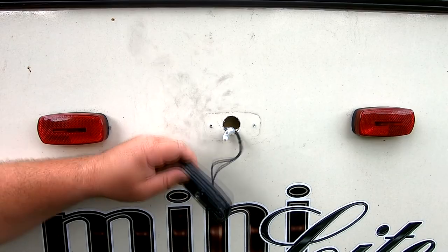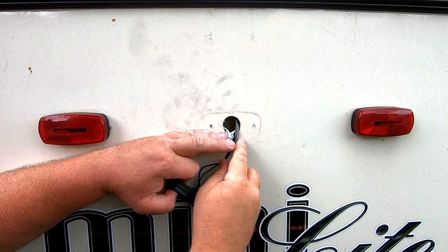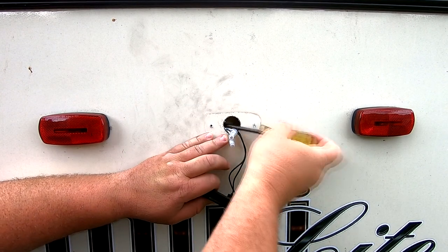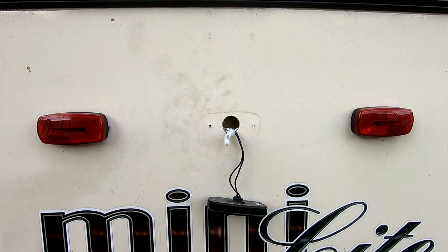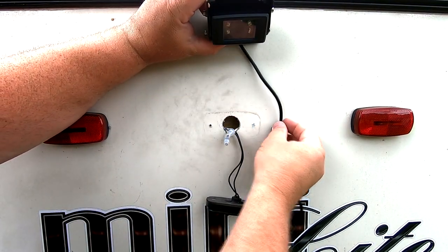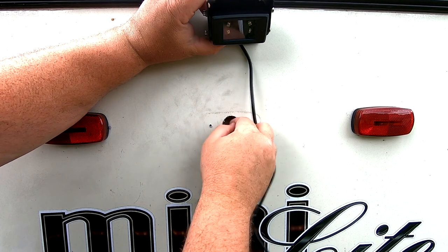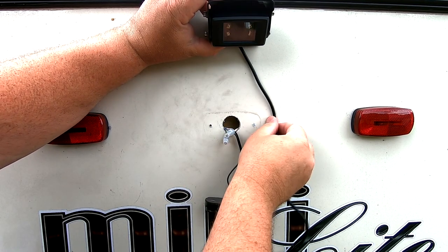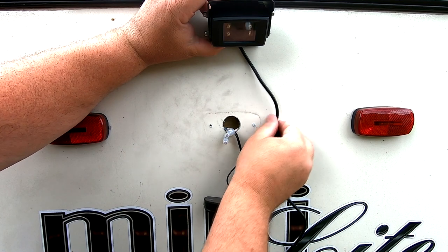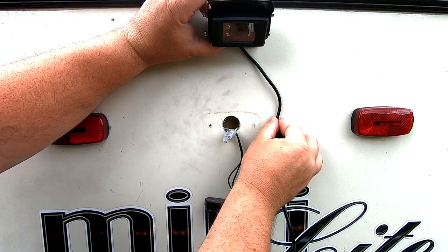Just doing a little feeling around with the screwdriver, there's something pretty hard — some kind of a cross brace in the top of this hole — but it's void to the right and to the left. So I think what I'm going to do is just mount the camera right about here and run the wire down and drill a three-quarter inch hole, then run the line in here and tie it into the wires. It will be nice to have this wire hidden, but it's only about a five-inch wire and it matches the color of the trim and the graphics, so I'm not really that worried about it.